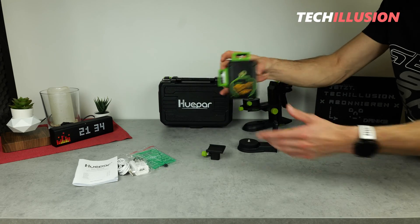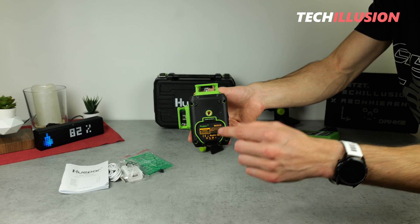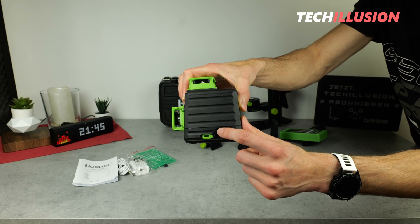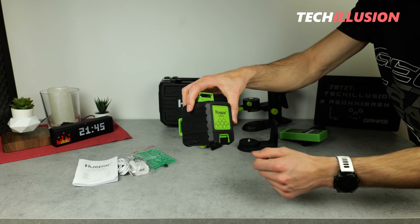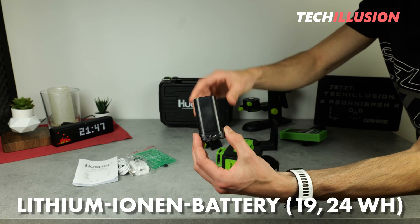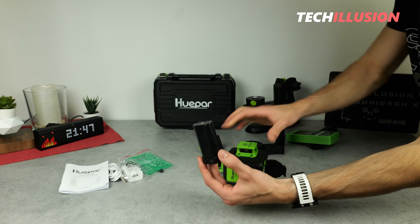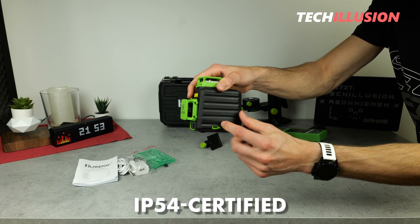Right under the thread is the battery compartment cover. The cover will rarely need to be opened, since on the left side there's a small concealed USB Type-C port for charging the device from the outside. However, the latch can be quite challenging to open with bare hands — you'll either fiddle with it or use a pointed object. Inside the compartment is a large 19.24 watt-hour lithium-ion battery, which can also be charged via the USB Type-C port. Its large capacity provides a runtime of just over 6 hours in practice. Due to the rubber covers over the ports, the device is IP54 certified, making it splash-resistant.